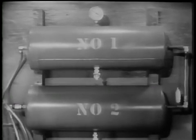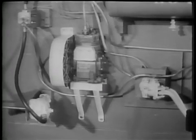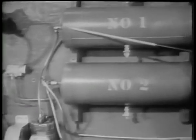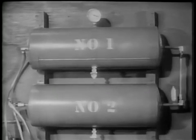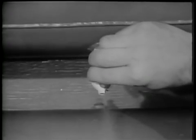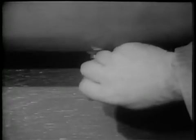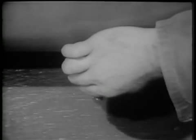As you can see, there are two reservoirs in this air brake system. During compression, the air is heated. As it flows through the lines into the reservoir, the air becomes cool and its moisture condenses out into water. The first reservoir is called the number 1, or wet reservoir. It is mainly used as a moisture trap in which nearly all the water can be collected and drained away when necessary. The number 2 reservoir, the dry reservoir, drains off the remaining water and supplies dry, compressed air to the system. Normally, the reservoirs are drained every day.